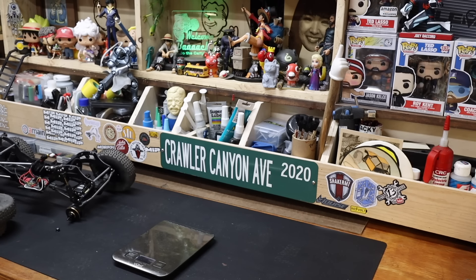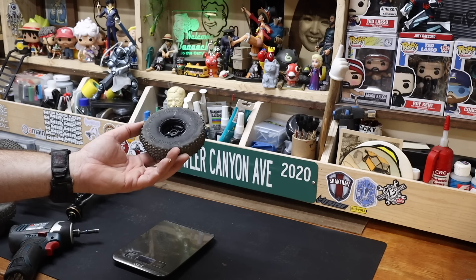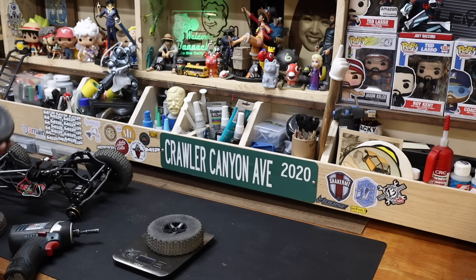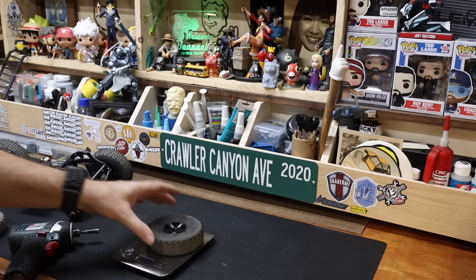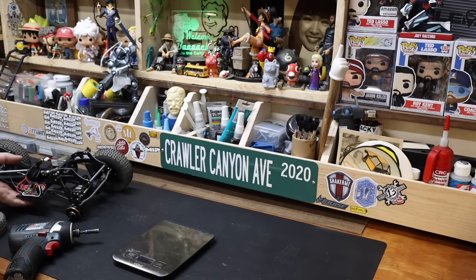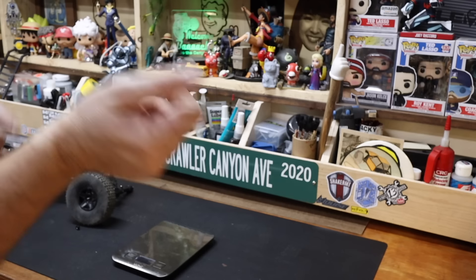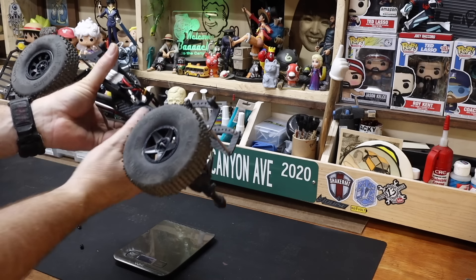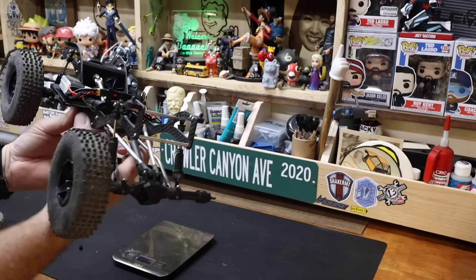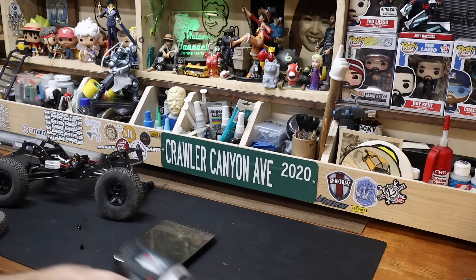We replaced the rears by digging through our bin of glue-ons and finding some MST five-spoke glue-on wheels. 100 grams for the alloys, 77 grams for the glue-ons — actually pretty light, and you're not getting lighter than that. This feels like nothing, like it's floating through the air. Also, these are aluminum lock nuts, and anywhere you see a shiny fastener it is now titanium. I went through a couple bags of titanium fasteners including some on the axle — shaving a bunch of unsprung weight along with sprung weight.